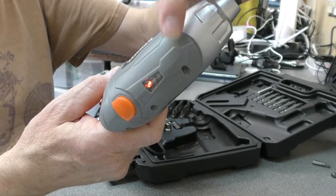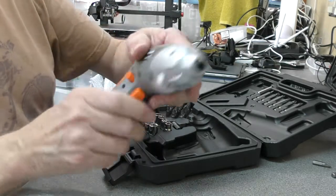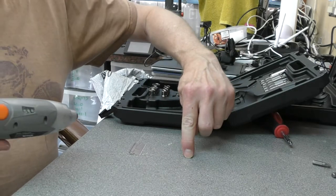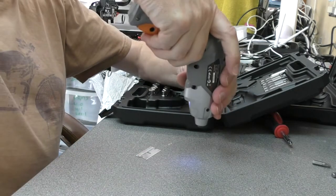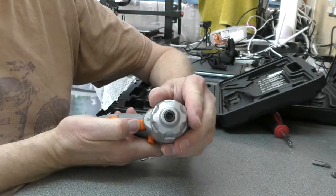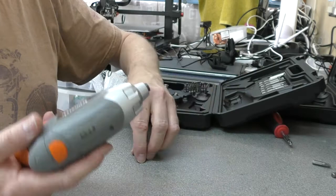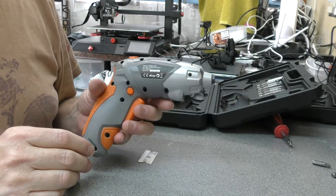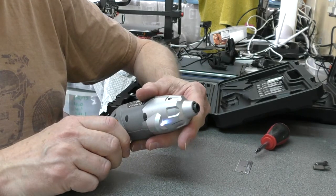You would think that perhaps when the charge goes up the LEDs will light up further, but that's not the case — the red LED will simply go out. Now there is a light, but in my opinion it's pretty useless. If you're working on a screw, the light is not actually on the screw. They've also made a big mistake in that the operation of the light is dependent on the operation of the whole screwdriver. They really need a two-stage switch because you do not want to be popping a spinning bit into a screw head. You're going to have to spend substantially more to get the light coming on first so you can line it up.